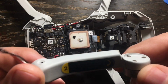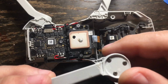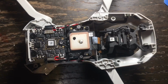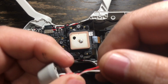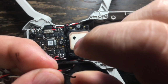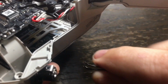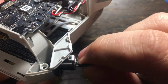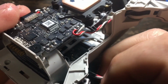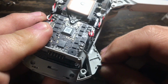Upon inspecting the arm, you can see that this was clearly wrecked. It's cracked and broken, and the motor has also taken damage. Now, you want to take the new arm and twist the 3 wires into a kind of spiral shape. This lets it fit inside the metal tube, where the leg goes into that bracket, a lot easier. So you push it inside of that metal tube, and you'll see that you cannot push it all the way through.